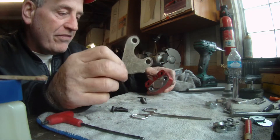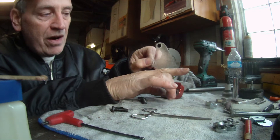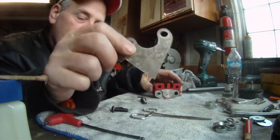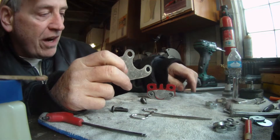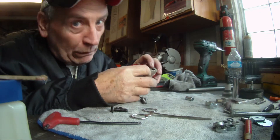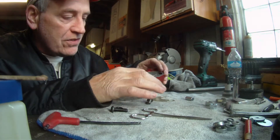I made this little mock-up out of fiberglass to be able to get the angle right on the spindle arm, and then transfer it to the steel before we cut the steel and cut it wrong. It's a good idea if you've got plastic or even a good piece of cardboard — thicker cardboard. A Budweiser box tends to work for that kind of stuff; it's about the right thickness and stiffness.